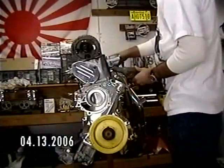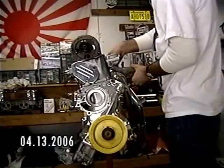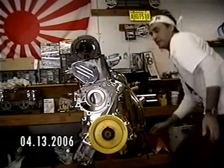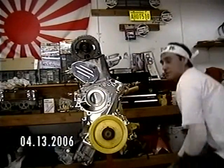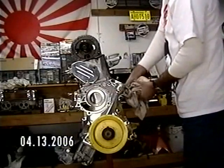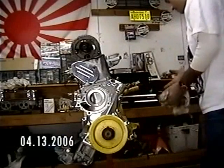Assume this motor is in the car — you will remove all your accessories. The L16 is pretty clean, you can get all the bolts pretty easy, unlike the later L20s which are really hard because you can't get your fingers in there due to the exhaust manifold being full of emission gear. Everything I'm saying is based on a square port — I run all square port L16s and L18s. I also pulled this crankcase vent out; if you're removing a motor, pulling this out lets you pull the exhaust manifold out and pull the motor straight out — it's quicker on the L16s.